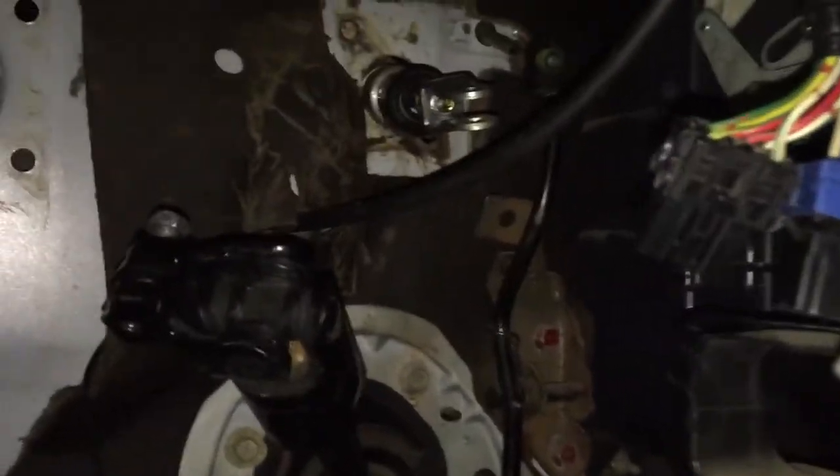They say to take this off and weld the bracket onto the clutch pedal. It works sometimes and sometimes it doesn't. If it doesn't work, I'm going to buy a whole new clutch pedal — they sell it on some website for about $80, comes with the bushings and the whole new clutch pedal assembly. To get this out it's pretty easy. I took the seat out because it makes a lot more room. You'll have to take the whole steering column out, then lay underneath and take out some bolts — there's the master cylinder for the slave and the brake booster.